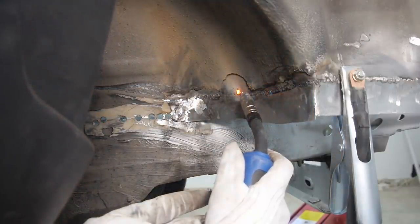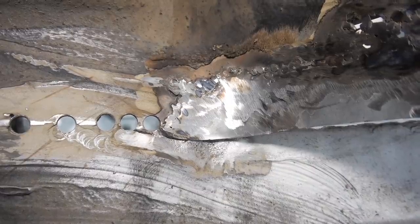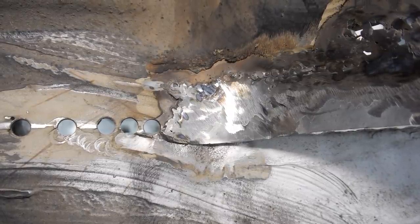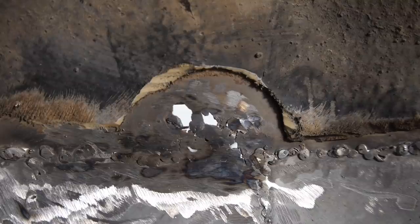Whilst filling the holes, I kept blowing through in one area, causing large holes to form. I tried lowering the welder settings and placing copper behind the welds, but I think the metal was just too thin and weak. I ended up making a right mess of it.